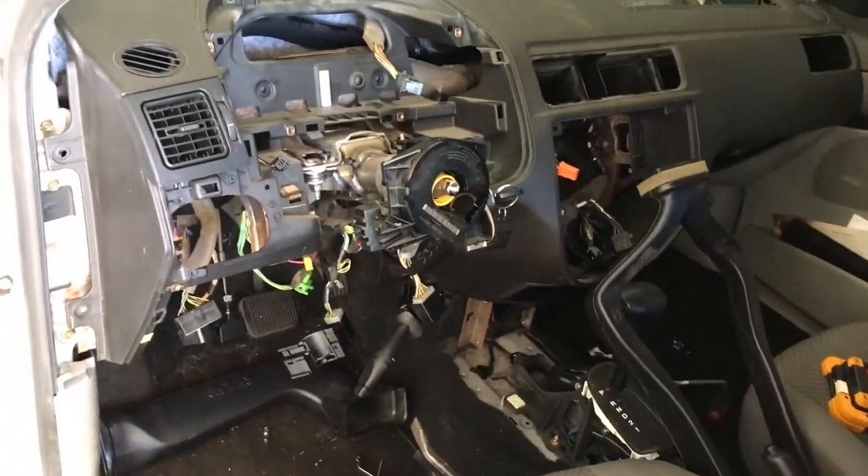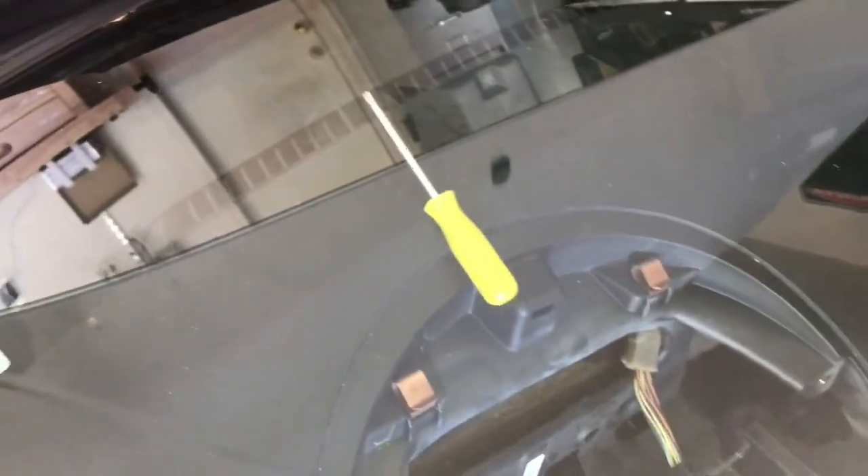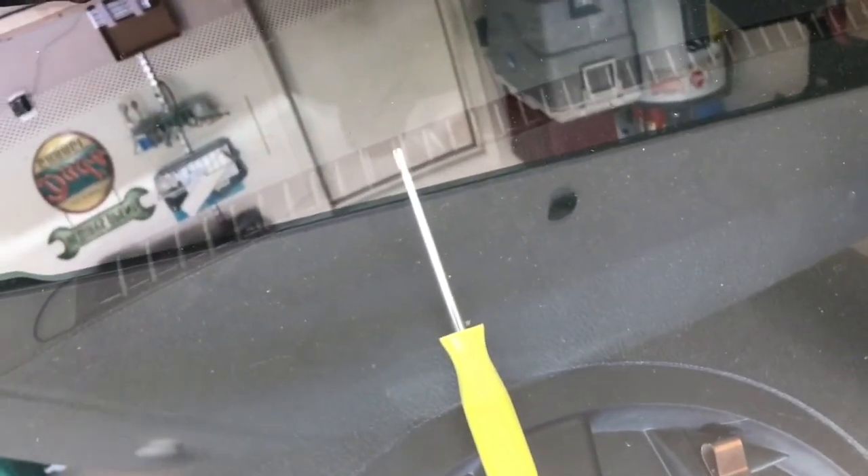About ready to pull this dash. The only things left are three pins located right underneath the defrost vent that shoots through to the windshield — one exactly in the middle and one on each side. Here's the one on the left side. You have these normal vents, but you'll see a vent that's kind of doubled up on the edges there.